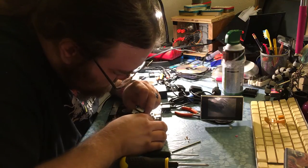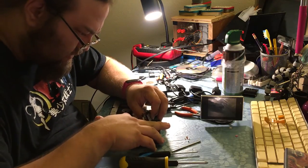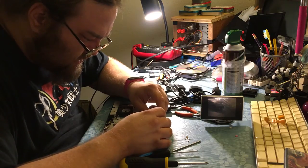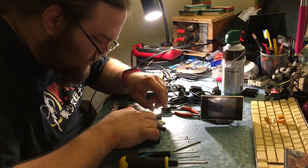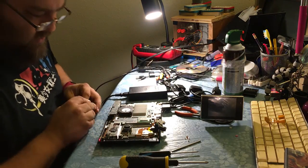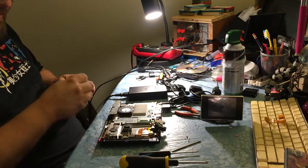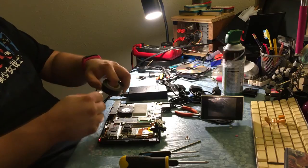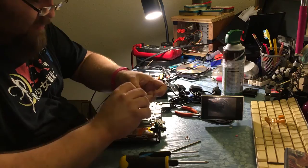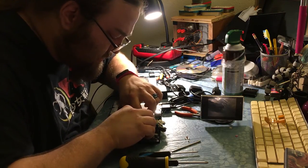Okay, I can see an adhesive line on the cable and on the base. It's not adhering there anymore. So what we're going to do is just sit this guy here, and try and get a small piece of tape across that to hold it where it was originally. Because what's happening is it's allowing the cable to come up more than it normally would. So there's excess cable getting pulled up as it's coming forward, and that excess cable is rubbing against the disc.